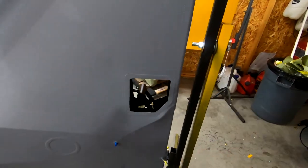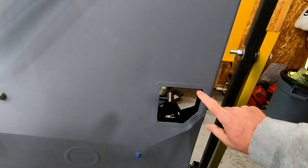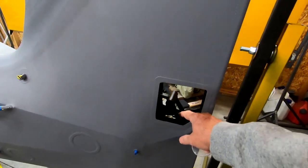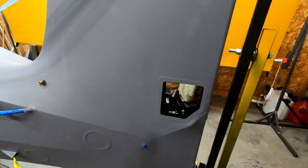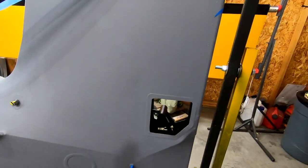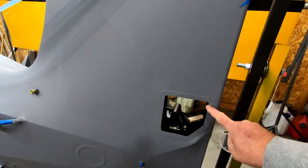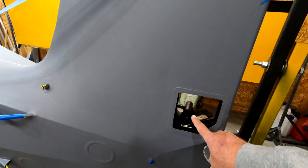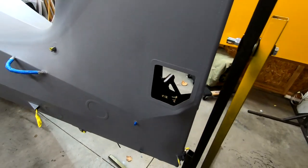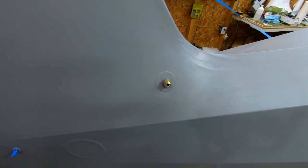I want to thank Waylon Aircraft - he was awesome and showed pictures of this on his last build. I contacted Just Aircraft and bought this little kit that gives you access to your push rod connection for the elevator. You lay this into the fabric, glue it on, cut the fabric, bring it up, trim it, glue it around, then put a patch around it. I'll drill out the holes and run a piece of clear plastic pre-cut to the exact diameter, with a crescent shape so the elevator can move up and down, but the rest is sealed - giving you a nice view to confirm your connection is solid.